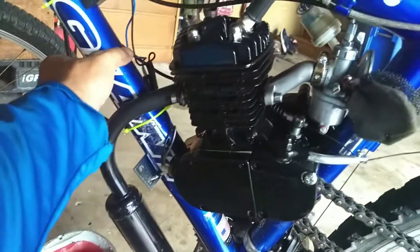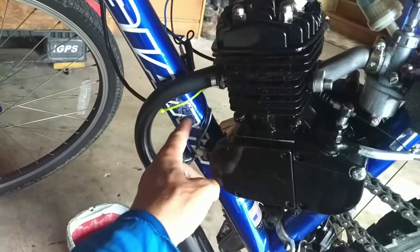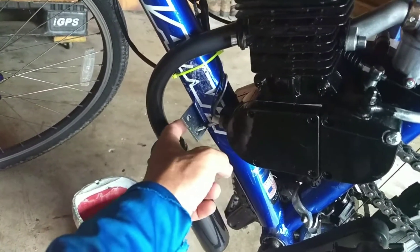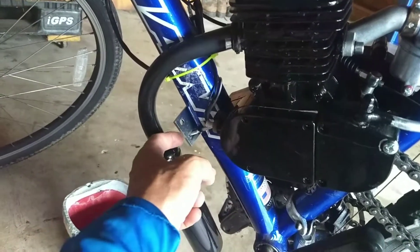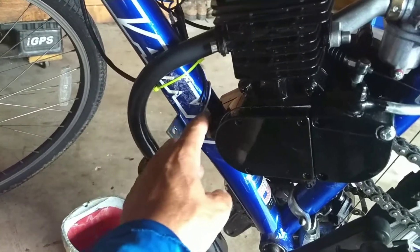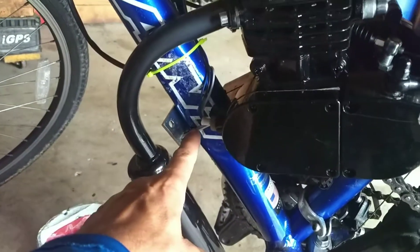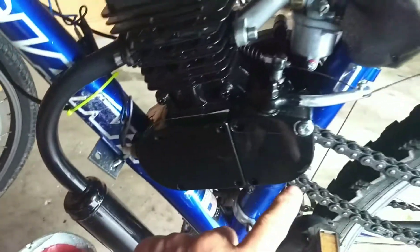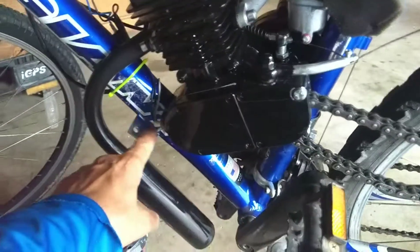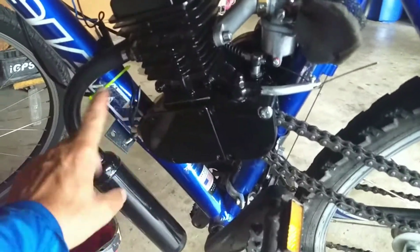On this particular model of bike, the diameter of the aluminum was too big, so I had to use a persuasion bar to pound these over and use another piece supplied in the kit. It ended up mounting around the side instead of a nicer, cleaner look. The bolts in the back were longer where I needed them, so I flip-flopped the bolts from the back and vice versa to make it work.